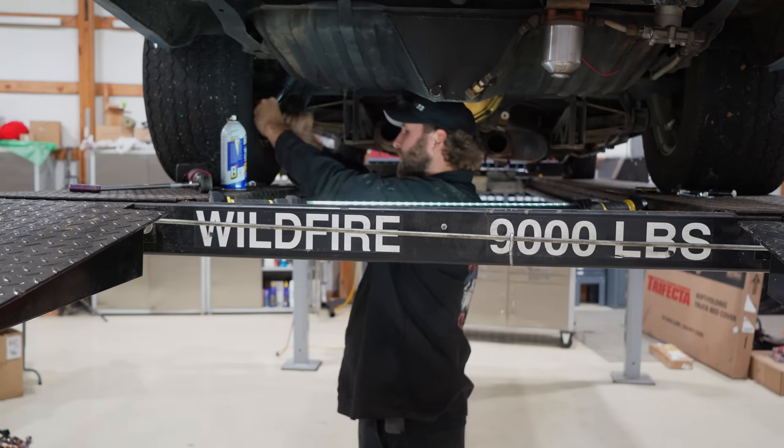Also, in the trailing arm unit that hooks into the homemade thingy on the bottom, that bolt is too short, I'll show you here in a second. It only has a split washer on it again, and that's flayed open, also very loose. We need to get a longer bolt in there. If I pop that puppy loose, then we're gonna have, this is dominoes. Not the pizza, the theoretical mess is what we got. Got to noticing this. I'm actually not tightening anything.